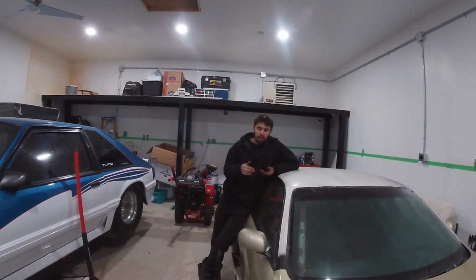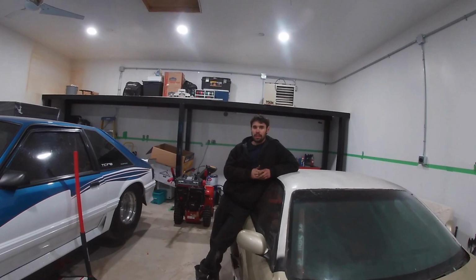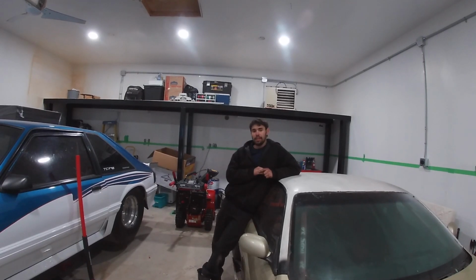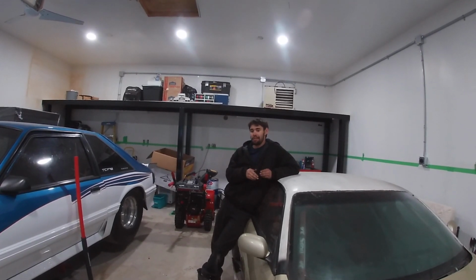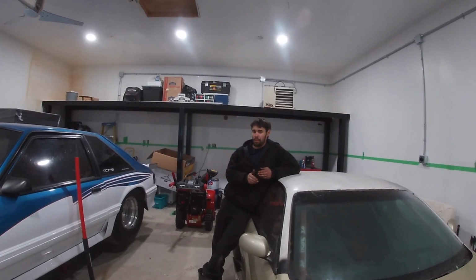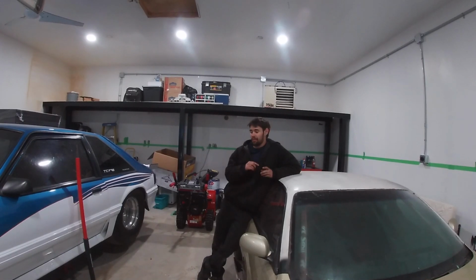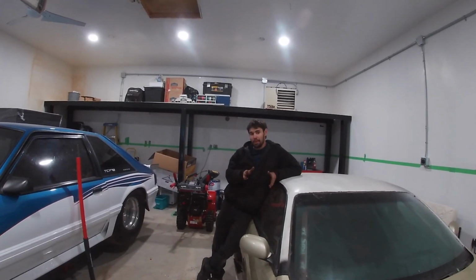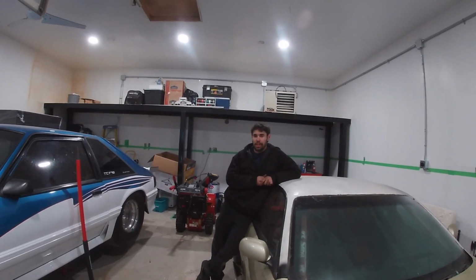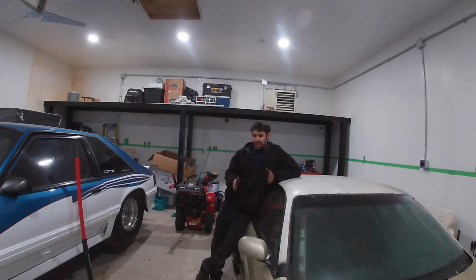and then the weekend after that we wanted to put another edge on that, so we ended up getting a set of used radials. Tried that. The car actually was crazy. First time ever, it went 1.23 60 foot, carrying the wheels about 200 feet. So that's about what we wanted. The only downside, and we've come to the conclusion this is the problem now, is that the back wheels are bent. So it got into a pretty violent shake, which sucked.